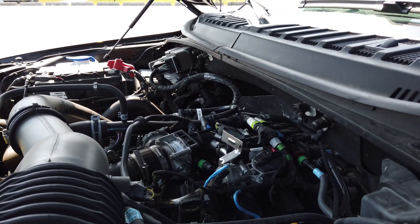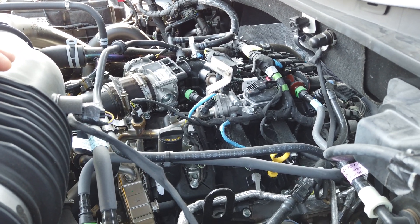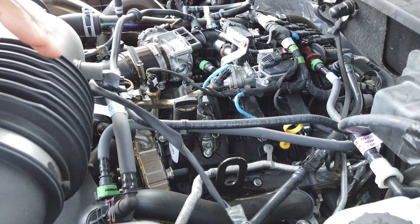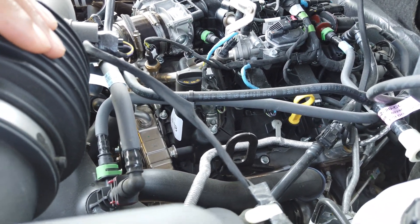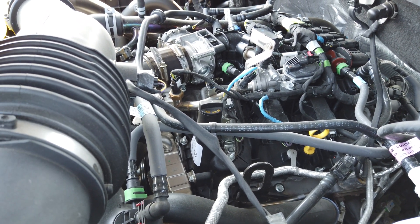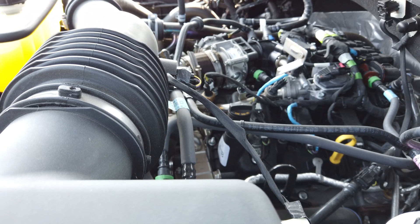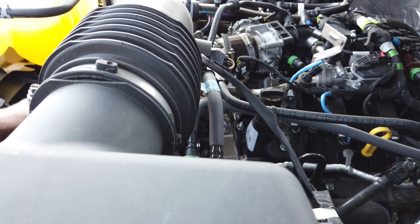In doing research I found some very interesting things about this engine. The two-piece engine block essentially means the middle section of the engine is iron, while the heads are aluminum with water-cooled integrated exhaust manifolds. But I don't think being two-piece makes the engine any weaker. The reason is that the midsection that holds the pistons also holds the connecting rods and the crankshaft.